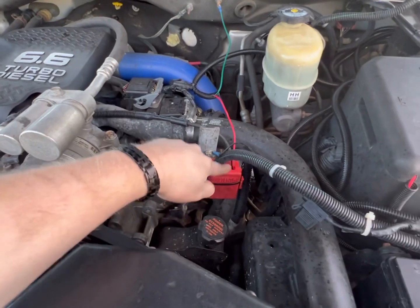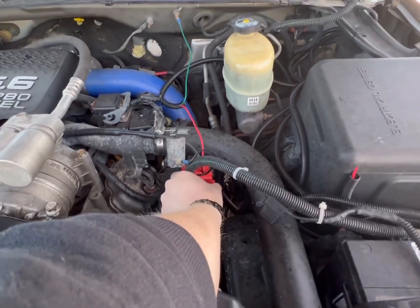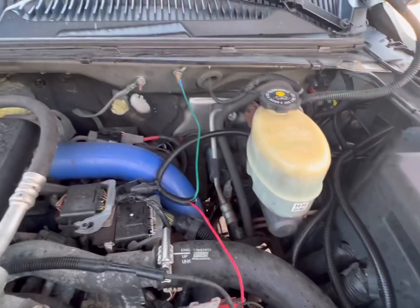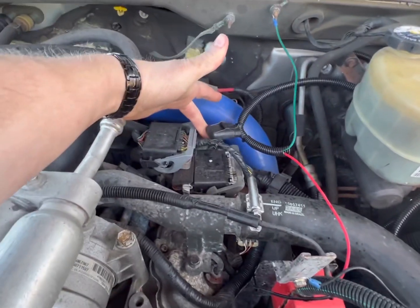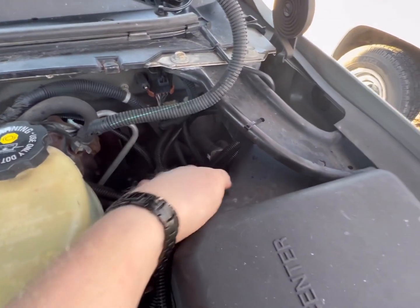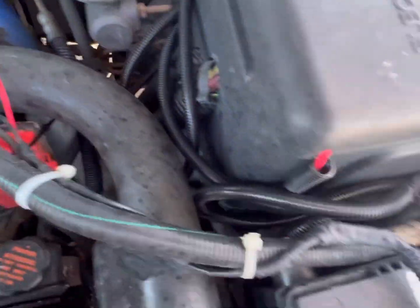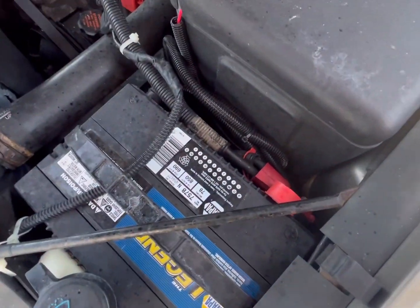I don't have the proper battery bolts so I hooked up the FAST direct — you can slide this up and pull this back. Power is run off the junction box here that we use for jump starting other vehicles, so I put that there. The ground is here where the hood ground goes. Our inline fuse is with the injection system harness — it runs back and I have everything bundled and zip tied together, rolled up as nice as I could get it. The line runs right along the ABS lines up around into our battery location.